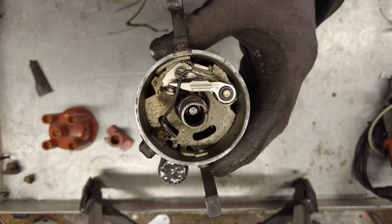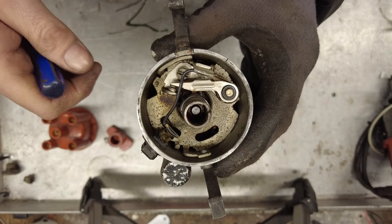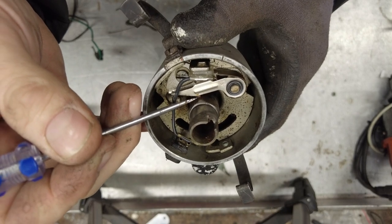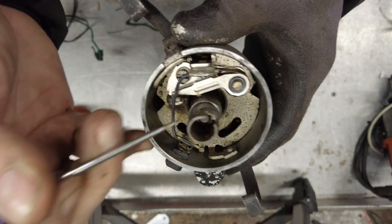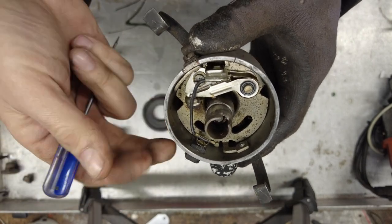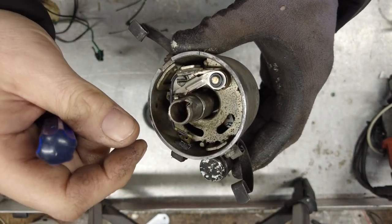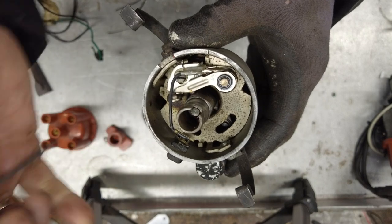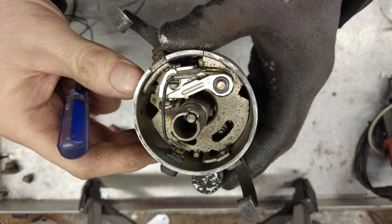I'm not going to do a video today on setting the points gap or using the dwell angle, but I'm hoping to do a video later in the year where we'll do a complete engine setup, so watch out for that one. The first thing I didn't really know about was the little pad here — there's a little pad in between the shaft and the points. If you open it up you can see a little block there just in front of the screwdriver. That needs to be lubricated, so you need multi-purpose grease — pretty much anything will do. A little bit on your finger, wipe it around the shaft. Clean it off first, then fresh grease — you'll need a very small amount. A bit on the shaft and when it spins it'll keep that pad lubricated so it's floating freely.